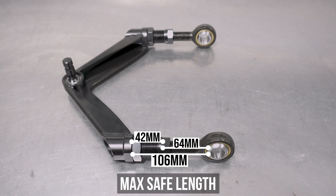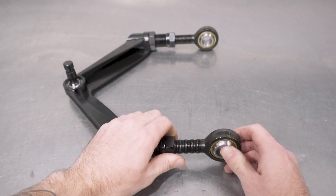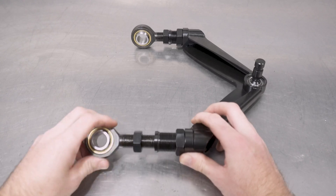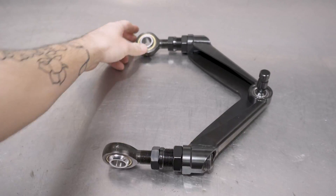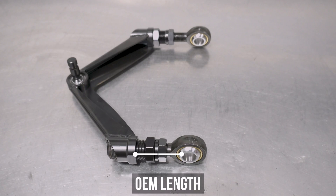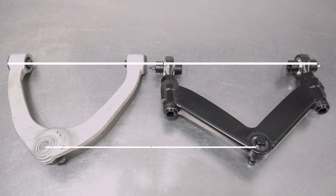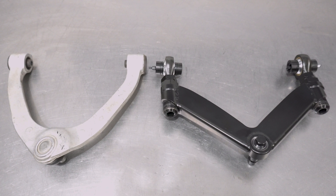Our go-to place for adjustments would be to set that sucker to OEM, because who knew better than those guys, right? You can use a large allen head socket to adjust the extended sleeve inwards. The all-important OEM measurements come in at 86 millimeters, measuring the same way as before, and this is made up from 35 millimeters on the extender and 51 millimeters on the heim, measured the same way as before. You could also eyeball the length by comparing the arm to OEM, but with all the hot new technology and measuring devices, why would you do that? Seriously, go buy a ruler.